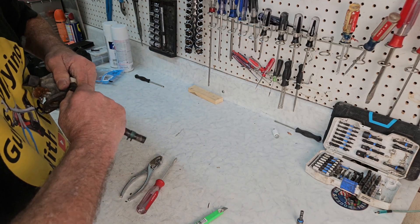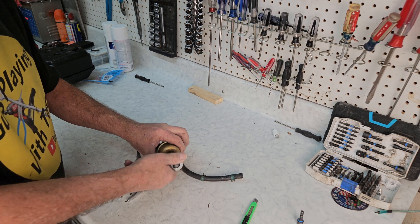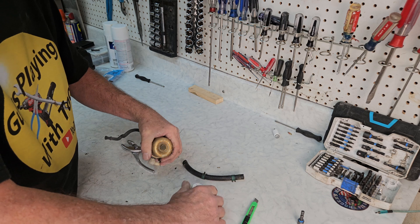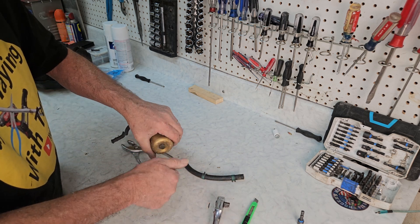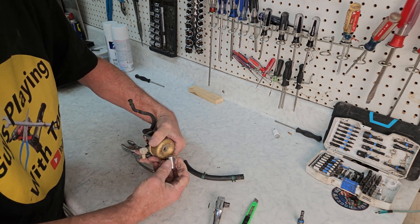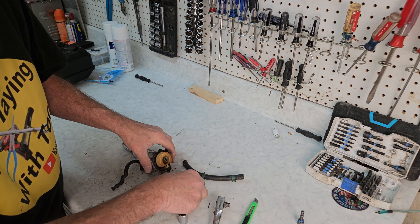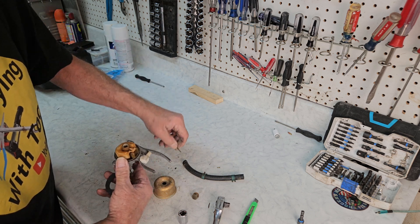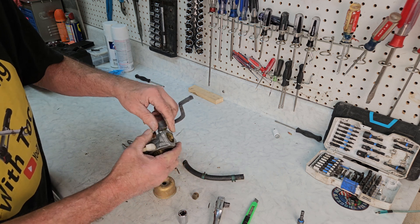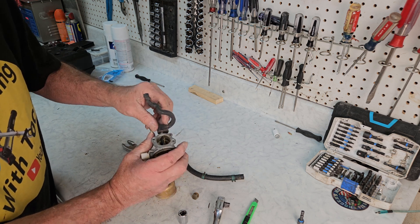Let's pull the bowl off. This is where all the magic happens — you can see because the bolt is brass colored, this is the jet. Yikes, this carburetor is not what I would call beautiful. Let's run it around to the ultrasonic and see if we can get away with it. I could pull this front butterfly off — yeah, let's do it.